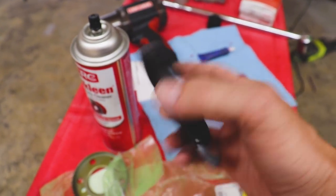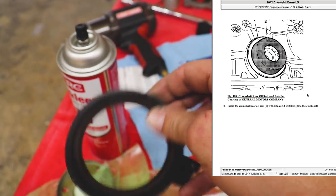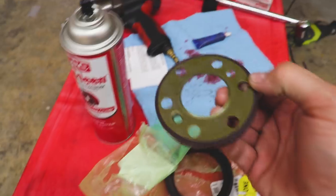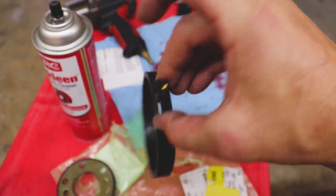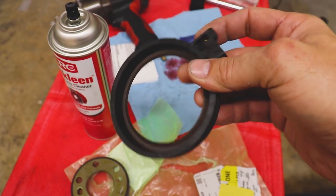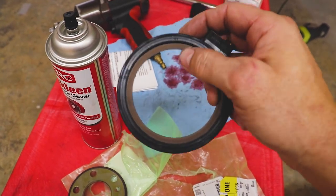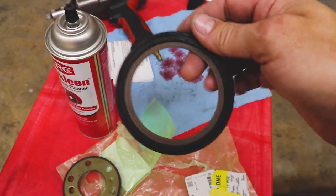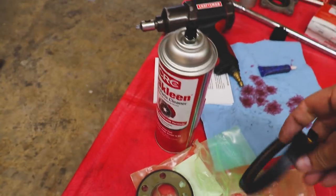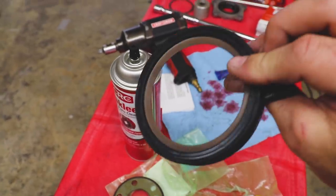I'm not sure if this is a housing or if there's anything magical going on inside this ring, but the instructions treat these as two separate pieces. The seals are supposed to go in first, then the reluctor ring, then this housing that holds the crankshaft position sensor. I did install it backwards initially — normally with V8s the lip is on the inside, but in this one the lip is actually on the outside.